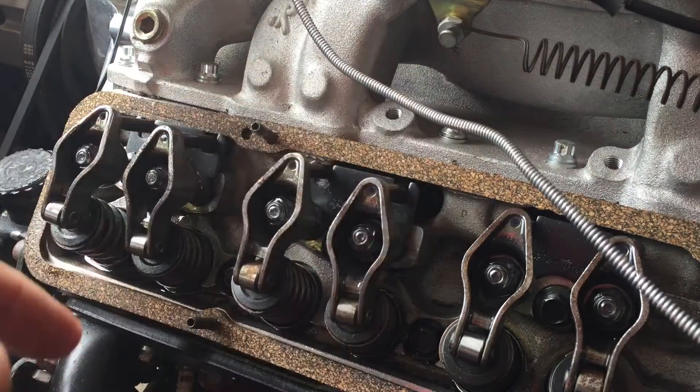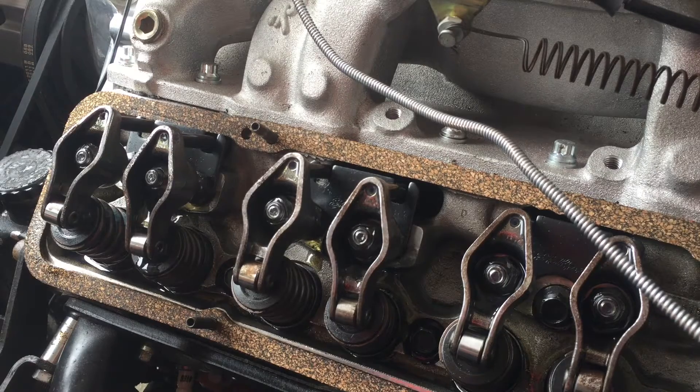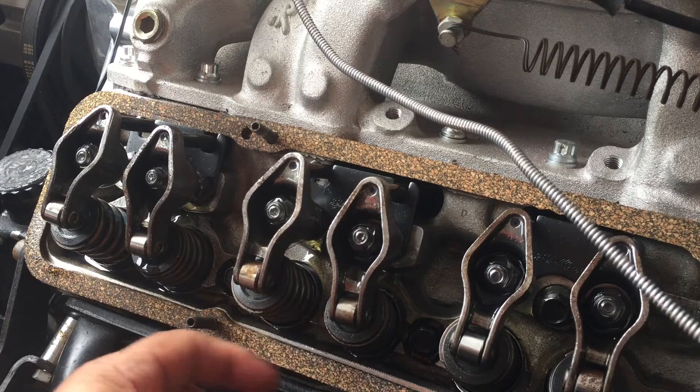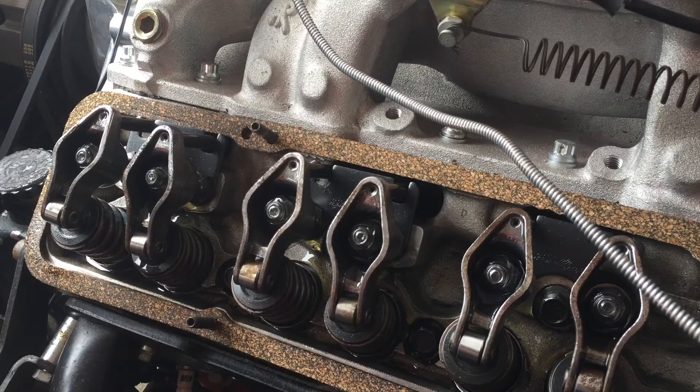You can't see back here but it's also oiling — oiling really well. I'll run it for a little bit to get all the air out of the oil galley. Before starting a motor, you want to make sure on your initial start of a new rebuild that everything is getting oil. You can see it's just pouring down here — I've got a lot of oil coming out. This is the left side, the driver's side.